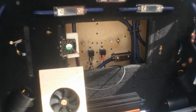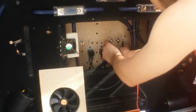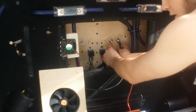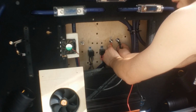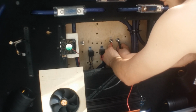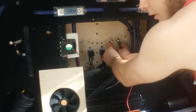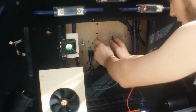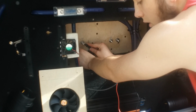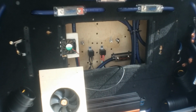All right, so we got our multimeter here. Set to ohms. Let's see here. Let's put a negative. These are dual 2 ohm coils ran in parallel, so it should be right about 1 ohm. And they're about, I think, 2.2s or something like that. So 2.4 actually. So yep, we're reading around 1.2, 1.3. That one's good. So check the other sub. And same thing, 1.3. So they're both reading pretty good. So now that all checks off.